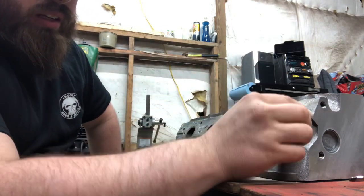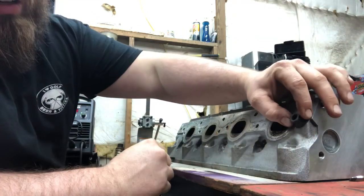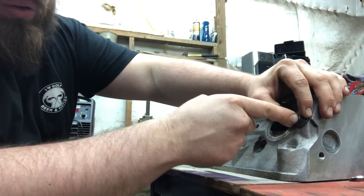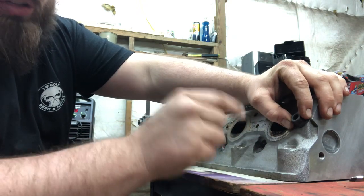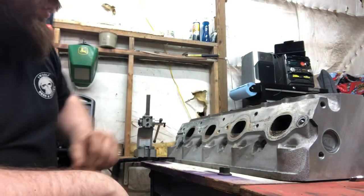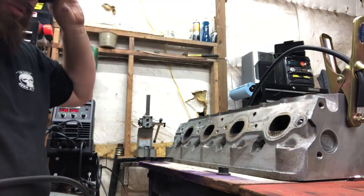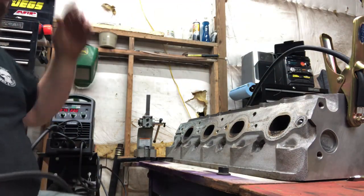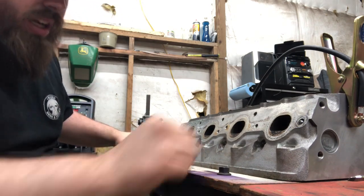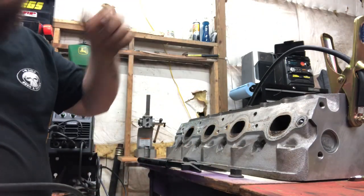What we're going to do is take the nut, center it over the broken bolt, and tack it until we get the bolt tacked on. Hit it a couple more times with the welder just to make sure we've got it good and stuck on there, and then we'll be able to back it right out with the ratchet. First thing — put your ground clamp on your head. It doesn't really matter where; it'll get it, but the closer the better. We're going to use our pliers to hold the nut and then tack it in there.